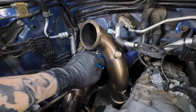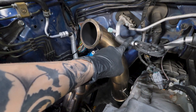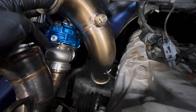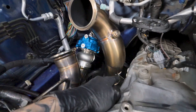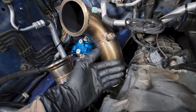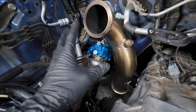Notice that the downpipe right now is currently resting on the wastegate - I still need to figure out that situation. We have about a finger width of clearance between the hard AC line and the downpipe. The downpipe is supported up by a bolt and there is a bracket on the downpipe specifically. I believe there is a margin as far as how far up or down you want to move the downpipe, and I think for my case I need to move it up.